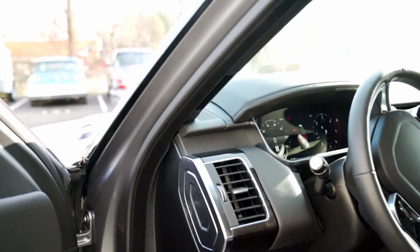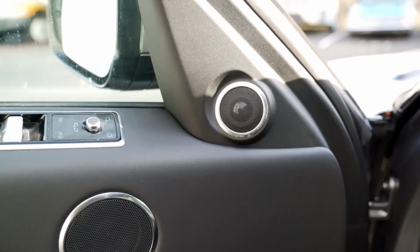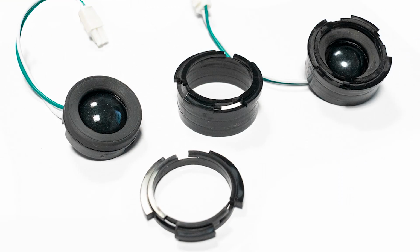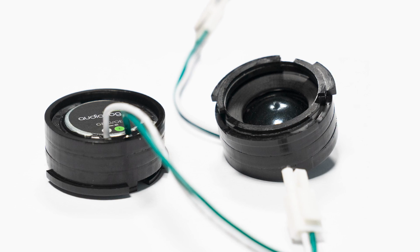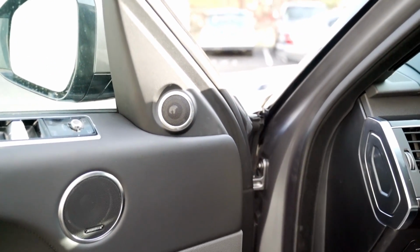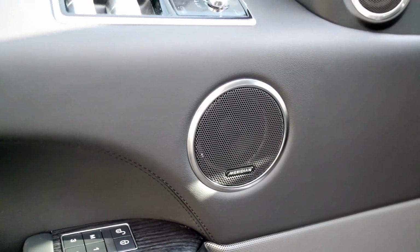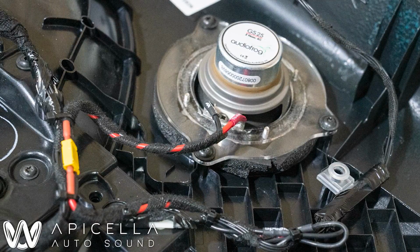So what we started out with was replacing the tweeters with AudioFrog GB10 OEs. We ended up fabricating our own mounting ring that snaps into the factory mounting locations. We actually have a separate video on that. I'll include the link in the description. From there, we did the AudioFrog GS25 mid-range in the OEM location.